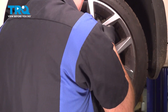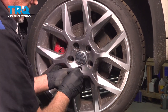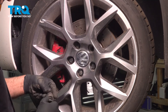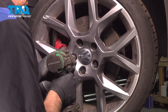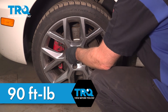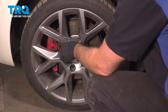Now put the wheels on, get those lined up, and get the lug bolts started. Snug those down. Now I'm gonna torque the lug bolts to 90 foot-pounds in a cross pattern to tighten the wheel down evenly. Just go around again to double check.